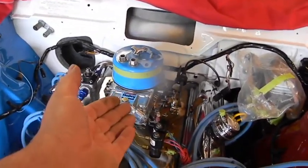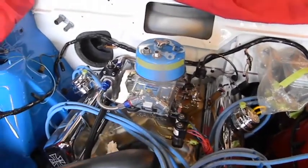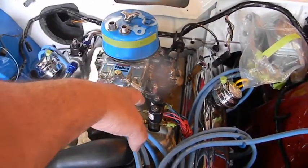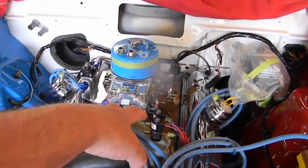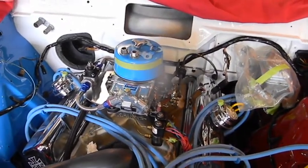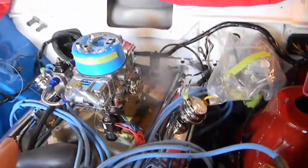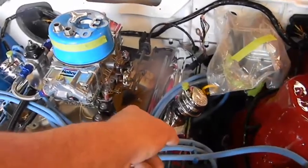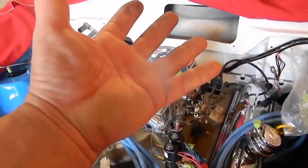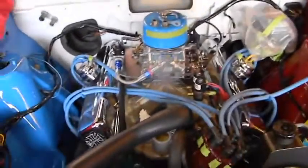And the conversation is, well, you don't have the right gasket on there. Yeah, you're correct. You can let the intake manifold get 250 degrees, put the right spacer on the carburetor — it won't be 250 degrees. But when the air and fuel hits it, it's hitting it at 250 degrees plus because of the crossover. And that's fine on a winter day, but not good on a summer day. So does this thing work? I have no clue. All I know is the fact that there's an air gap there that keeps the runners suspended and cooler, and I have no exhaust crossover. That's all we care about at this point.